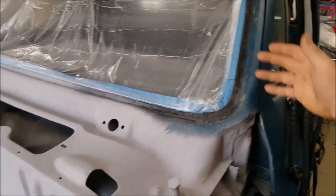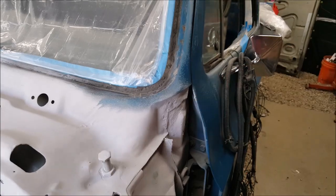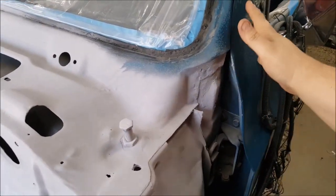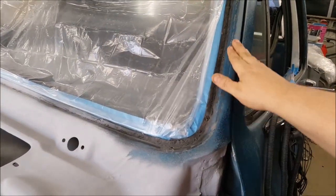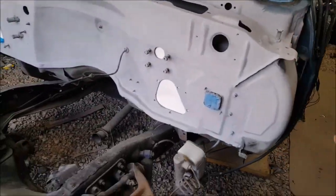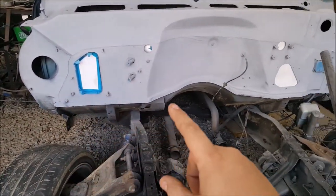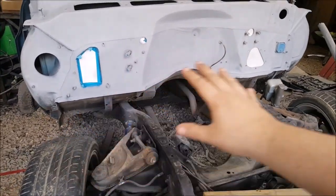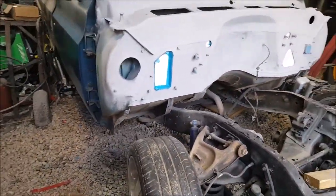What I'm gonna do is, with the plastic over here, I'm just gonna flick the paint — not going to the top, just flick it and try to blend it in, not hitting any of the outside of the doors. Same on the other side where it goes way up here, same up there. After it dries, right there at that bottom body line, I'm gonna tape it off and cover everything up there to paint the frame.